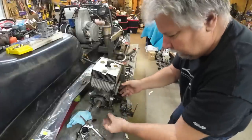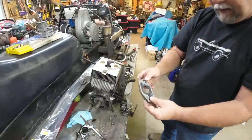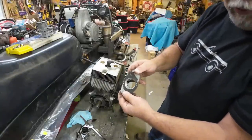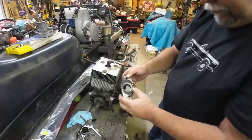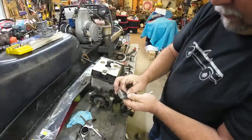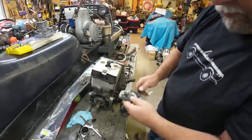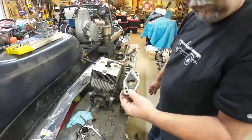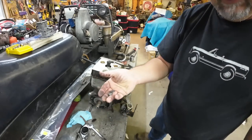All right. So here's those low boy nuts. And here's my fancy adapter I made. Custom gasket. And you can see I taper bored it on the lathe, and I don't know, once again it was for some kind of racing class. Oh yeah, you can see I'll rip this gasket a little bit, but I made slots to capture the hex on those, so I didn't need a wrench on the backside. We're done with this. I mean, you never know, I'll put it in the pile. You never know what the future holds, but for now these are what I need to proceed.